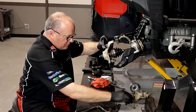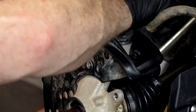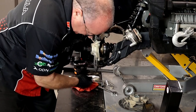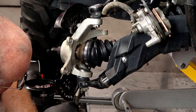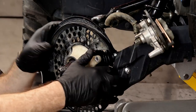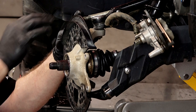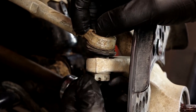Get the lower ball joint on, get it started, then the upper. We're just going to snug them down first, then get them torqued. The lower ball joint gets set to 22 foot-pounds; we'll get the cotter pin back through. The upper is 18 foot-pounds. None of those holes lined up so I put just a little bit more on it to get it through — sometimes it takes what it takes. Now let's get the steering arm on; this one has a washer on it and it goes to 18 foot-pounds.